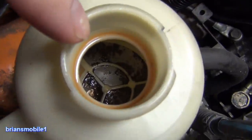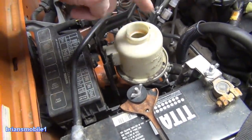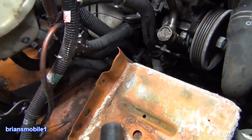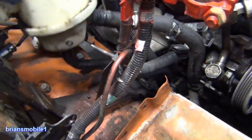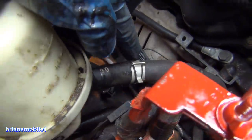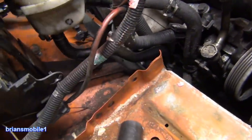What a lot of people mess up is they don't go through and clean out the system. You can flush all the lines all you want, but if you don't look in the reservoir and back-flush it — take it off, take it out, and either spray something safe for plastics in there or back-flush it from the other side — you'll miss debris. When hoses get kind of old, look at how much play there is. This clamp isn't spring-loaded, and that's why everybody uses spring-loaded clamps — they keep applying more clamping force with time, whereas a fixed clamp doesn't.